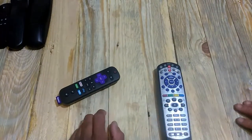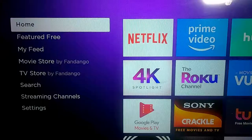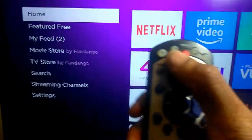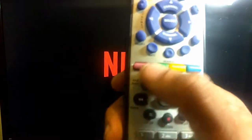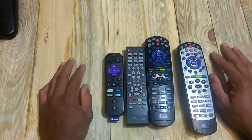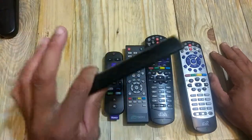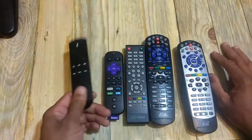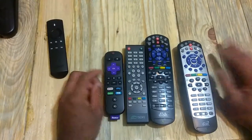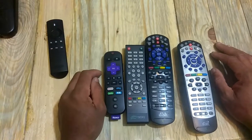Now I'm locking in those codes. Let's plug the Roku back in and see what we got. Here we are at the Roku screen — I used TV mode — so pressing the Red button should take us to Netflix. And there you have it! Teaching your Dish Network remote new tricks. Note: it will not work on an Amazon Fire Stick remote because the Fire Stick remote is not infrared. Hope you learned something from this video — be sure to hit that Like and Subscribe button, and I'll talk to you guys next time.